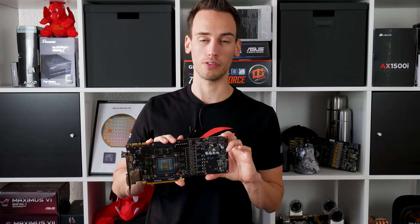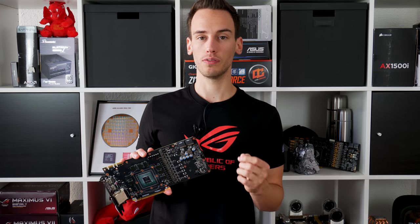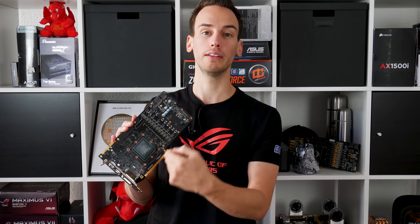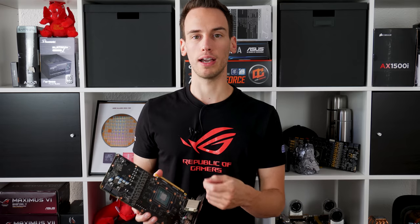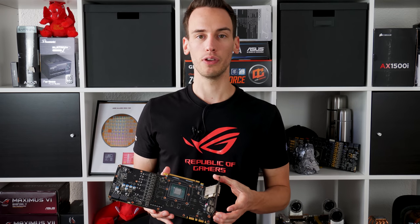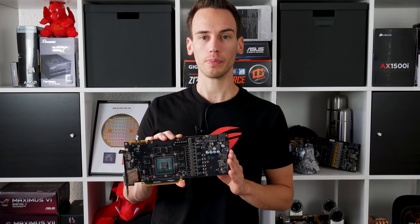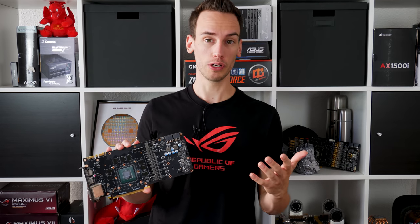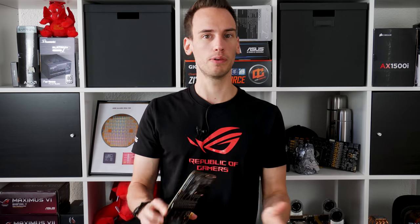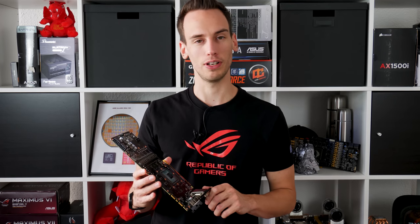Typically nowadays I use Vaseline. Previously, four to six years ago, I always used Plasti Dip or liquid tape. Liquid tape is convenient — you just apply it over everything and peel it off afterwards, and the hardware looks like new. But it takes a lot more time to prepare, maybe three to six hours to dry. If you have a lot of hardware to test and want to do it quickly, Vaseline is a lot more convenient, even though it gets everywhere — on your keyboard, mouse, screen — it's a real pain.